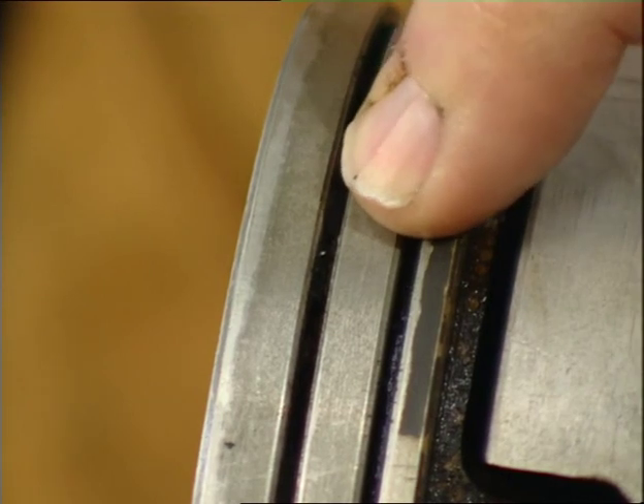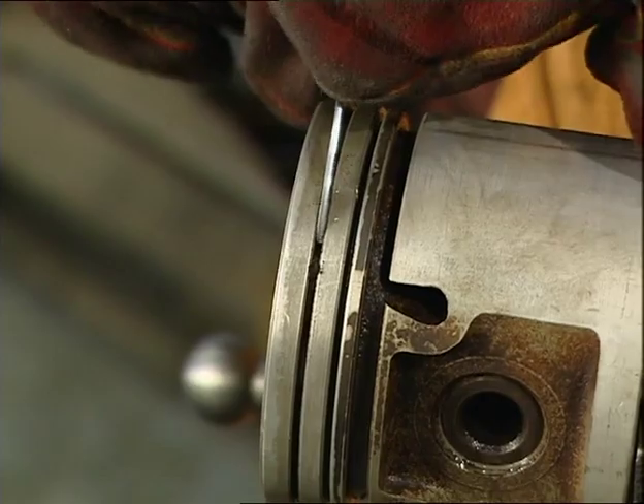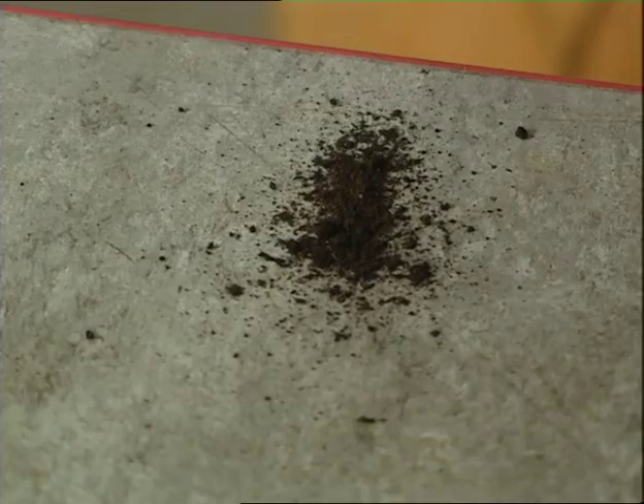Here's a little tip for cleaning out the grooves where the piston ring sits. Even though they've been in the degreaser overnight and brushed out with a nylon brush, you've still got carbon deposits in there. What you do is take one of your old piston rings that fits the groove and simply pull it apart — it breaks into two or three bits. You get a lovely sharp edge which is the perfect scraper for the groove. Quite gently scrape out the carbon; you don't want to scratch the aluminium. Do wear gloves because these rings are really sharp — look at all that rubbish coming out.